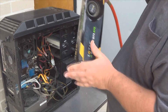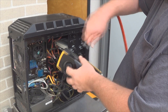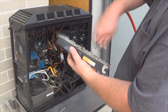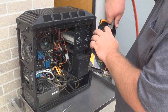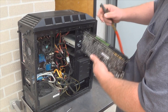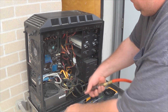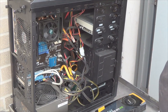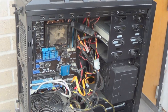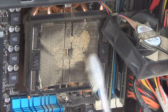Along with your video card, definitely make sure you hold that thing still. It's best to let the air compressor charge back up and re-blow stuff out again. I just removed the CPU fan off to the side — now we can see the heat sink. You can see how it clogs up in there.